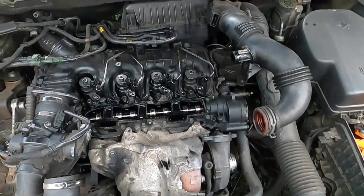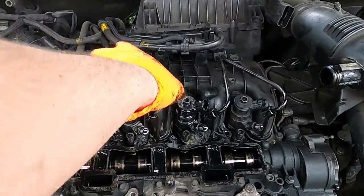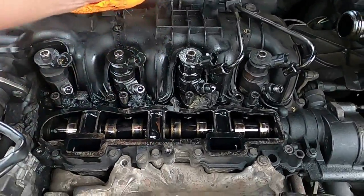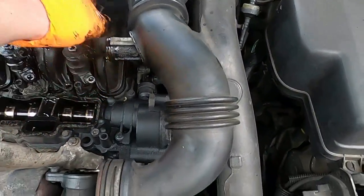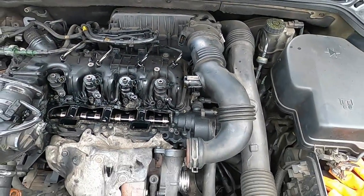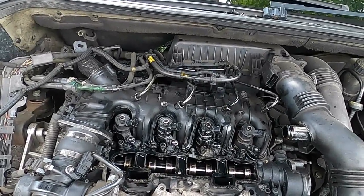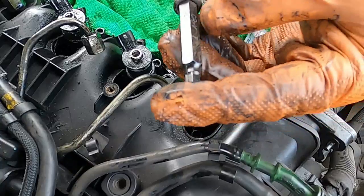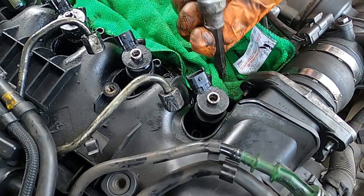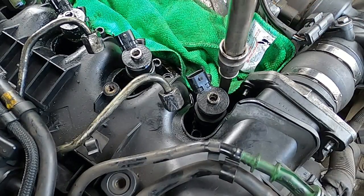What I want to do next is literally take these fuel supply lines and back them off a little bit — just a tiny bit, not too much. They're not going to break, they'll be absolutely fine. What we're going to be doing next is taking out the injectors. To remove an injector I'm using this CRV7 hex tool, and there are two little nuts holding each injector in place on each side, so you have to undo them.